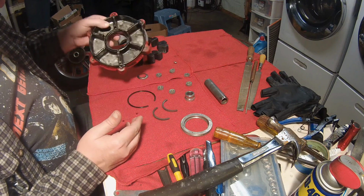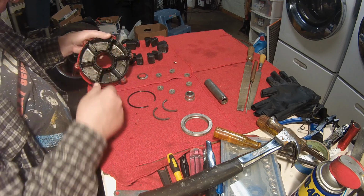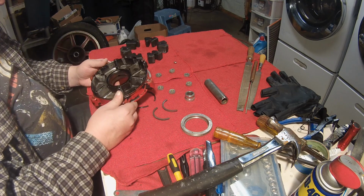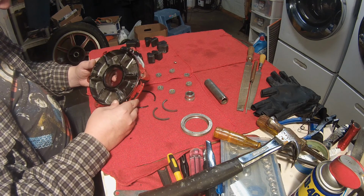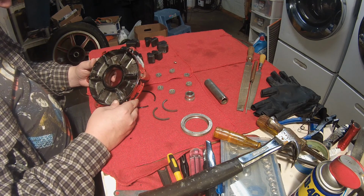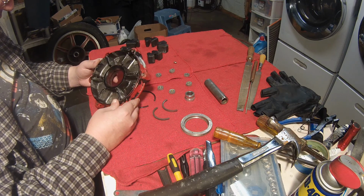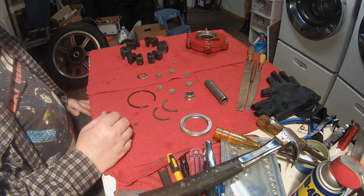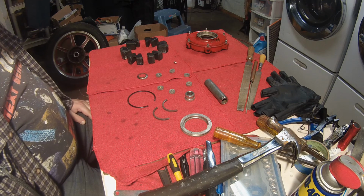It didn't come out degreased. There's still a bunch of grease build up in the corners. I gotta decide. This was originally painted. I gotta decide if I'm gonna repaint it or just put it back as it is. If I can't degrease it, I can't, and there's no point in trying to paint it because the paint will just fall off again.